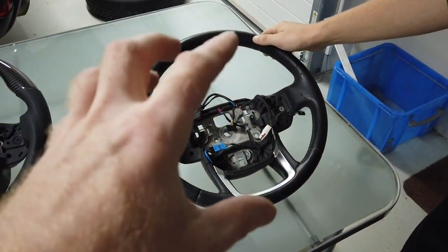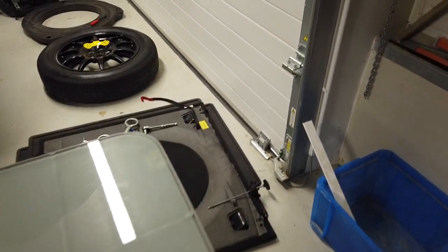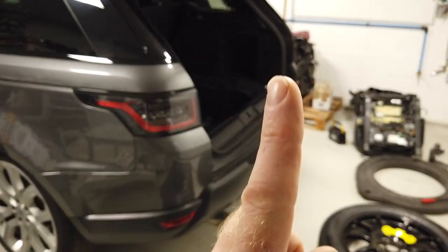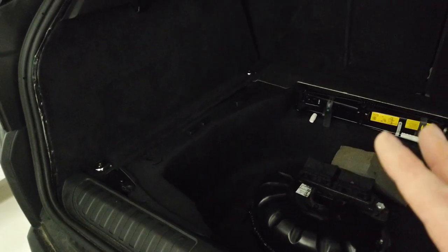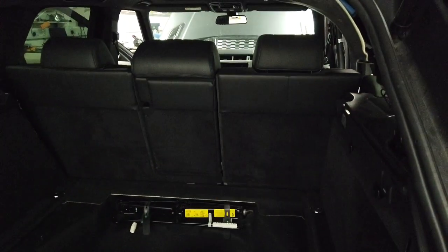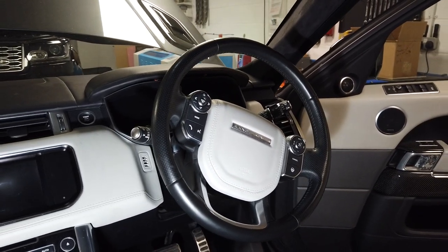That's what it looks like because it probably won't make much sense in the car. Safety first — we've got to disconnect the battery. I've done a full video on how to disconnect the battery and I'll put the link there, but basically you've got to take your boot carpet out, find the battery connector, disconnect it, and then leave the car 10 minutes so that all the power discharges from the airbag system.